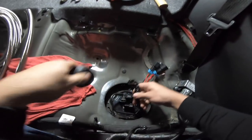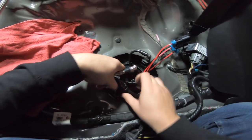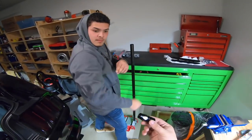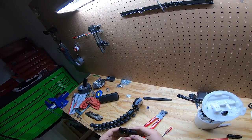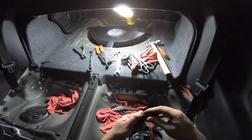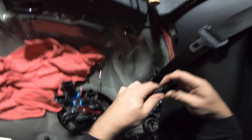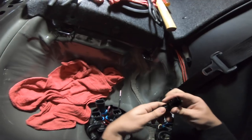We've got our old small fuel line right here. We've got our return line and we're going to use this good old-fashioned trick - we're going to tape this new line up to the old line and pull it through. I'm actually just now remembering that I do not have any soft jaw AN pliers for AN fittings like this so they don't get beat up. I don't want to beat these fittings up and make them look terrible. So I'm just going to be careful with them for right now, get some soft jaw pliers tomorrow, and we'll continue the fuel system again in the next video. I got the fitting screwed on as much as I can for now.